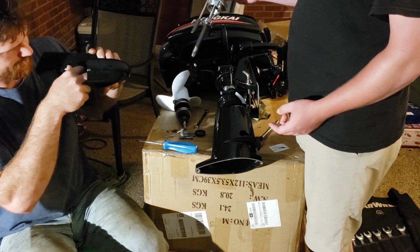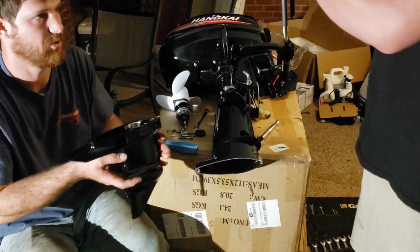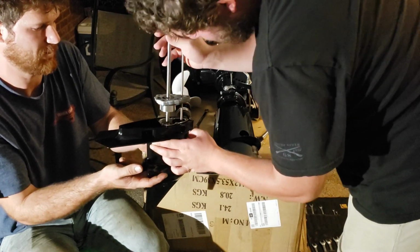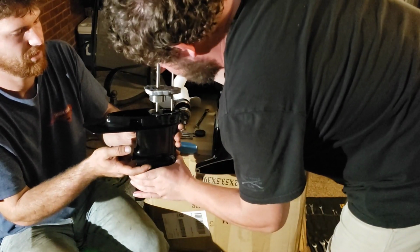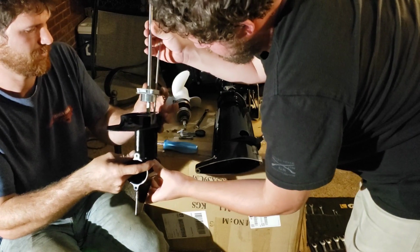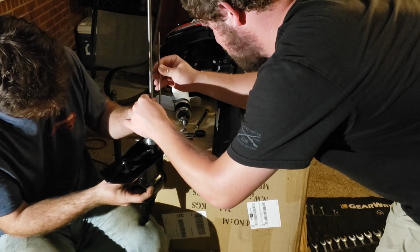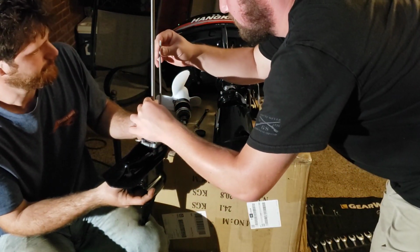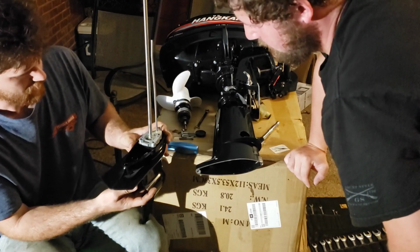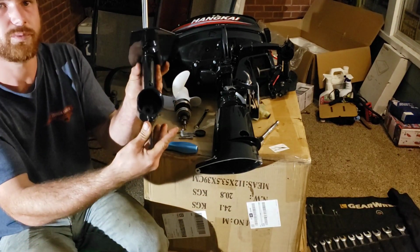So, all right. Make sure you do it. So we're going to hold it in there and align it so that the drive shaft will connect with it. Okay. Once it splines, spin it. Once it splines up on the drive shaft, it should also... Okay, hang on. I need to wiggle this down. Alright, hold on, let's listen in. Once that's down... Yeah, it's free right there. Once the shaft is down, then the little pinion gear will set.